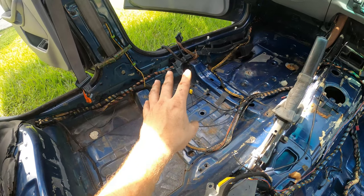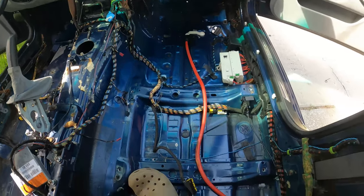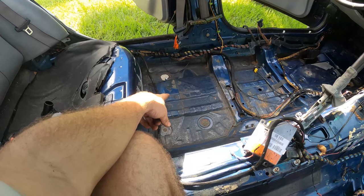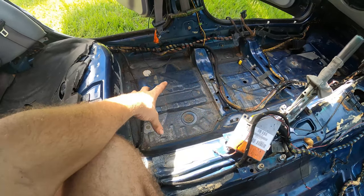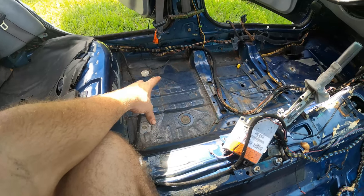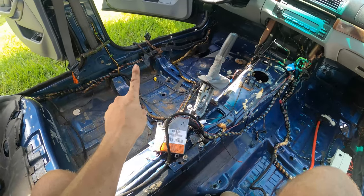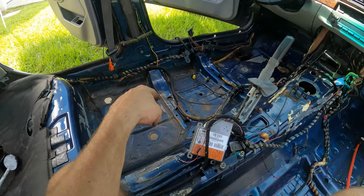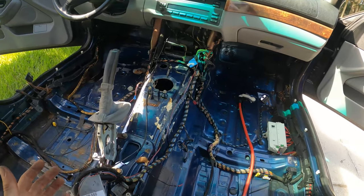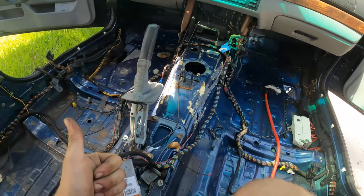But once we ground off all the rust with the brushes, then we vacuumed inside this car here. You can see this side looks super mint, not a lot of markings here. What we're gonna do is use a rust reformer, preventer, spray, anything would really work, clear coat or paint, but I'm gonna use a clear coat sort of rust converter. And then on the hole inside of the chassis, I'm going to be using a clear coat to make sure that this is sealed as best as possible. I'm sure I'm missing some places, and this isn't gonna be a permanent solution, but hey, I think it will last another 20 years considering the car is already 20 years old. So let's try to get rid of this rust and hope for the best.